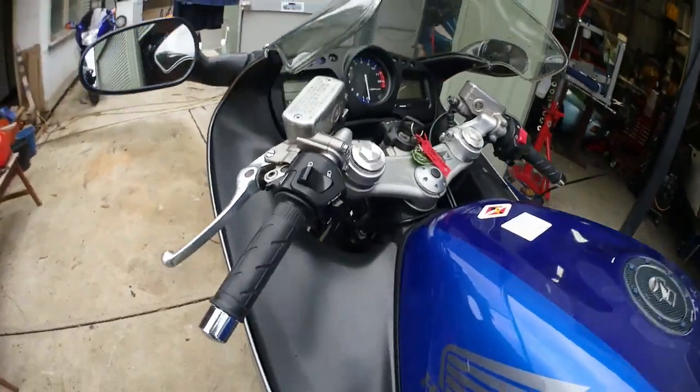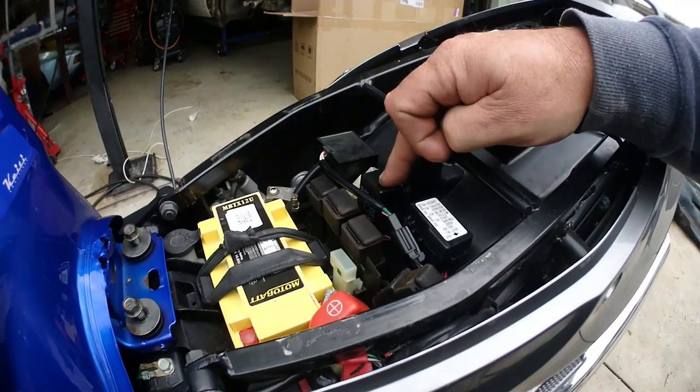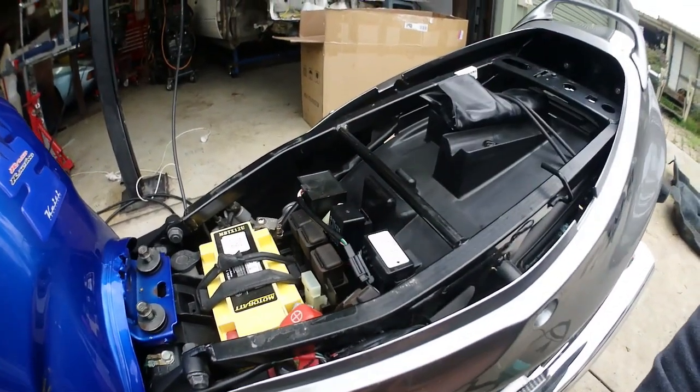So that told me straight away that it was only the fuel pump, because sometimes what it can be is this one here, or this one here, drives the electronic side of it, but everything else on the bike at the time when I was testing said that it was just the pump, and that the solenoid was clicking to say, you know, I want to work, but there's a resistance there. And that's what happens, they clag up. You flick them on and the resistance pushes back, and then it goes to the solenoid, and the solenoid switches it off. And if you tried to bypass that, the next thing you'd probably do is start blowing fuses, and then you'd start melting wires, because this poor little pump was seized jam shut.